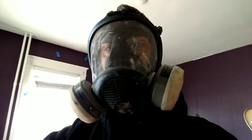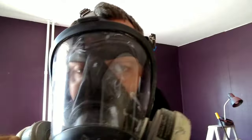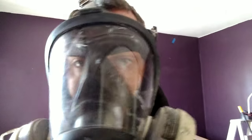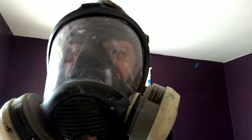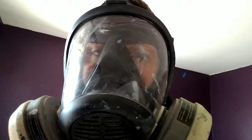Always wear your safety gear. I know it's kind of hard to see with all this sunlight coming in, but this makes a big difference. Not only do you not breathe the paint, you don't get it in your eyes. I always notice after a lot of spray painting my eyes feel kind of funny — it's because they got overspray in them. So get yourself a good mask if you're going to be doing a lot of painting. It's worth it.